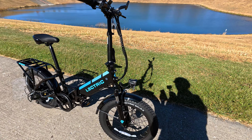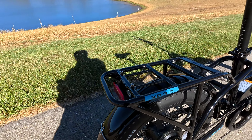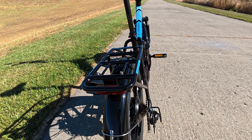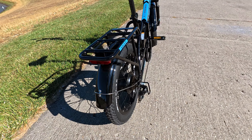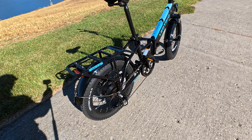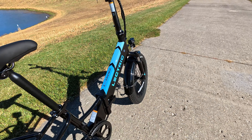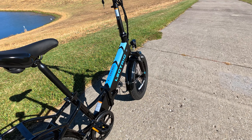You do have a front headlight and rear taillights in the back. Fenders are included and they are metal fenders — they look really cool and shiny, but any little pebble that goes by will make a noise. That is a drawback of metal fenders, though a lot of people like them because they feel like they're getting something solid. Personally, I prefer plastic fenders.